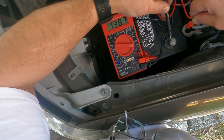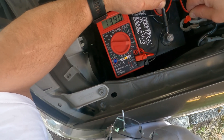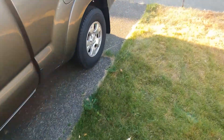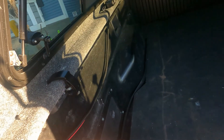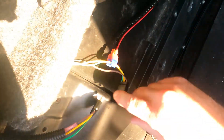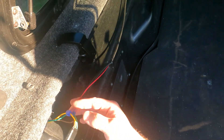With the camper shell connected it's 110 milliamps extra. And what's worse, even if I disconnect the wire harness in the back of the truck I'm still getting that 110 milliamp draw. So let me go ahead and open this up and disconnect this wire harness. There we go — this is disconnected. There's no way to disconnect the 12-volt outlet but I don't think that's the problem here. This is hardwired and I don't want to mess with any of this wiring.